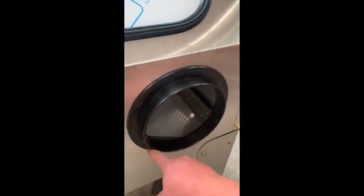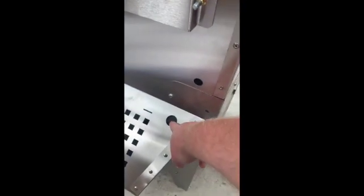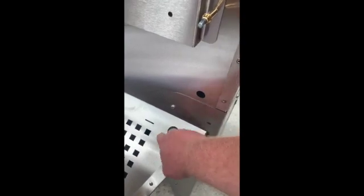Gauntlet holders: pop rivet all of those on using the longer rivets. Peel the tape off the backing, put the glove in, make sure the hands are the right way round and nice and level, peel it back, and stick it on — the tape just makes it easier to hold it in place while you get the jubilee clip on. Tighten up the big jubilee clip. For the trays: the one at the back has a big hole in the centre for the pipe from the pump; the middle one has two flanges; the front one just slots in place. All the bolt holes for the legs are the same — top and bottom. The electric cabinet tray is already fitted — all you've got to do is bolt the electric cabinet on. Feed all the wires through, wrap a bit of sponge around each wire, and force it into the hole to seal it nicely — same for the light at the top.